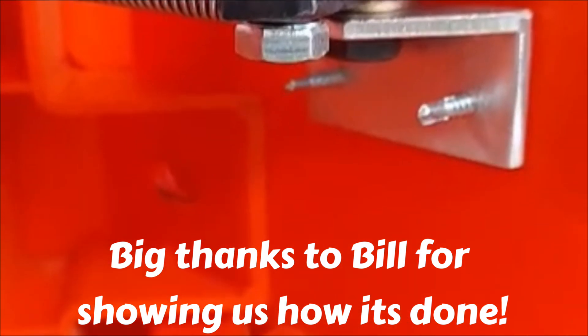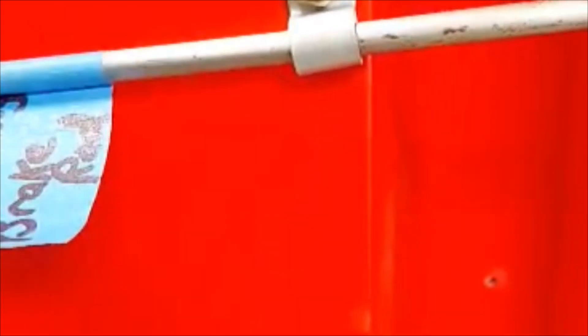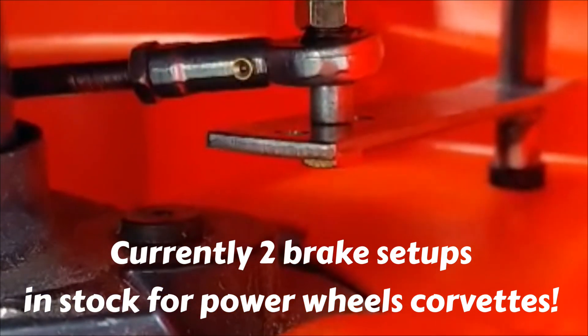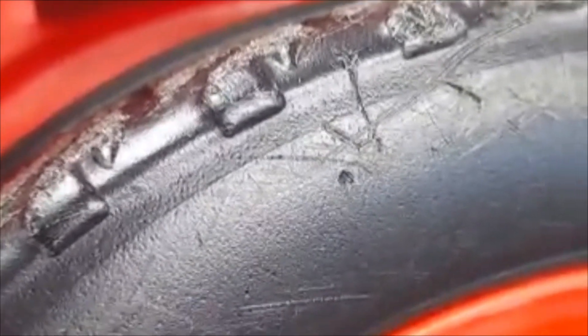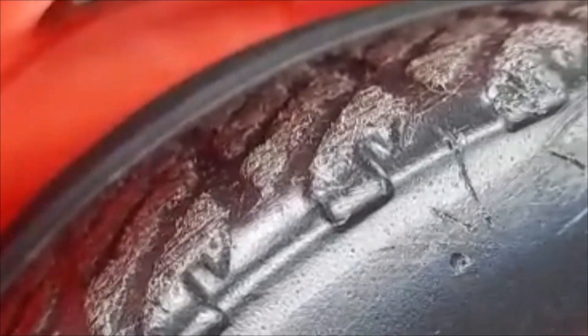You have your spring for the return, your brackets on the other side, and a rod end with adjustment. There's a little sleeve that goes between the pedal and the rod end. There's a clamp here to support the rod so it doesn't bow up. You'll also need to cut out two spots to get clearance where the rod goes over the hub. The pad will come down on the tire — try to keep that gap about the thickness of a paint stick. Depending on what you're running on your rear wheels — foam or double foam — you'll adjust your rod ends to get the correct play.